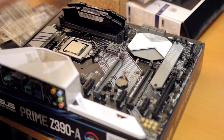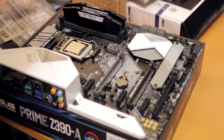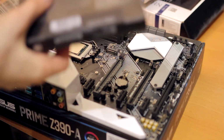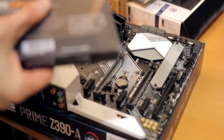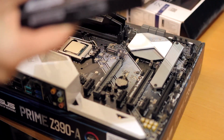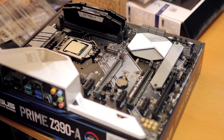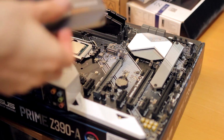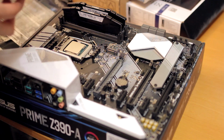And I guess last thing is now we have an M.2 drive. So, thanks to advances in high-speed storage, we get to put storage directly on the motherboard. M.2 I'd say is realistically a pretty good standard. I'm pretty happy with it. The confusion's annoying because they did SATA and PCIe, especially with how the slotting is. M keys are pretty simple because most everyone knows M key equals PCIe X4. But then you have B+M, which is normally SATA, but sometimes it's PCI Express X2.